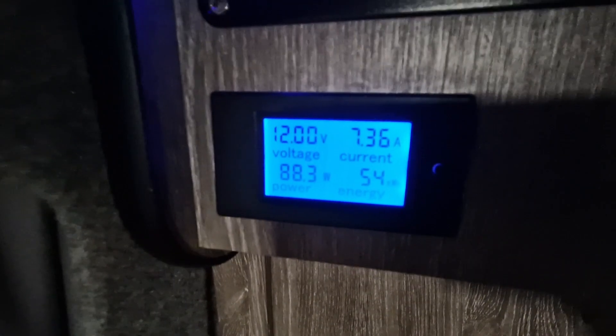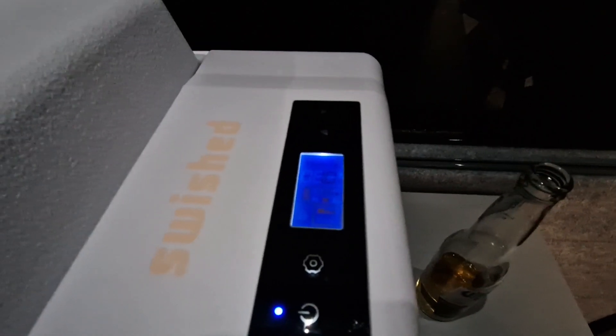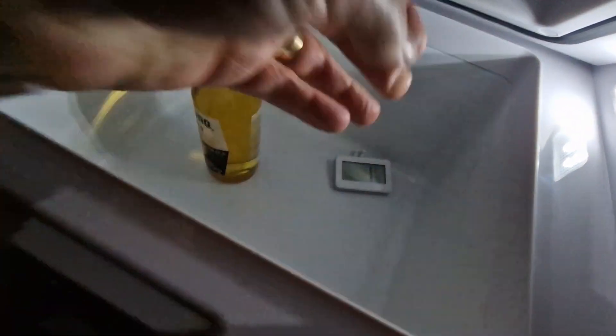We'll have a look at the power drain. So this is on permanent refrigeration at the moment - this is really pulling some power. Look at how many amps that's pulling in - 7.35 amps. That's a real draw on the power, I've got to be honest. It's actually saying we're down to minus 10 now. I'm not sure I believe that, so we'll just pop the lid open and the light will do its thing and we'll be able to see what the temp gauge inside is saying. That says 1.2 degrees. So we'll shut that back down again. And that's now saying minus 11 - not sure who to believe there to be honest. We'll give it another few minutes because expecting it to get down to minus 20 in 5-10 minutes is probably a little bit unrealistic.